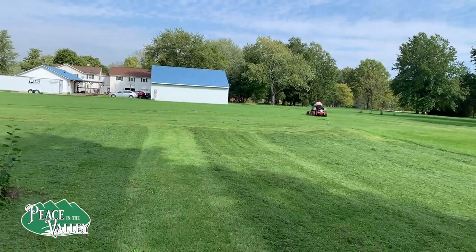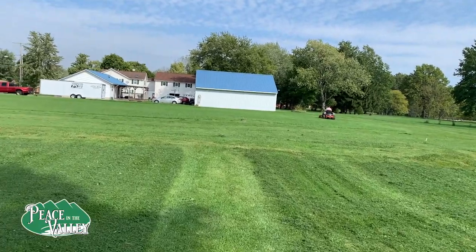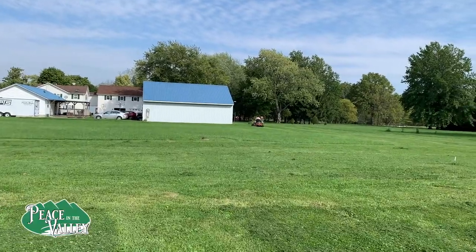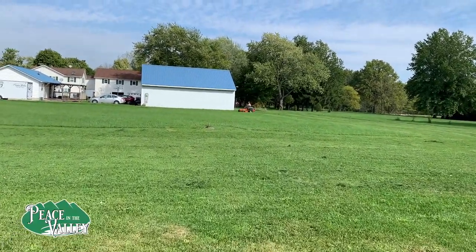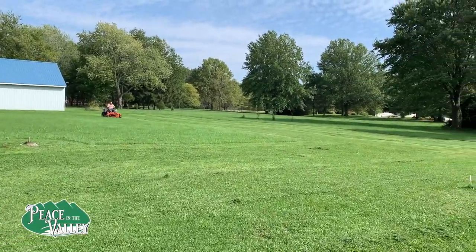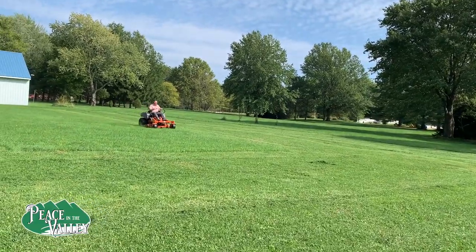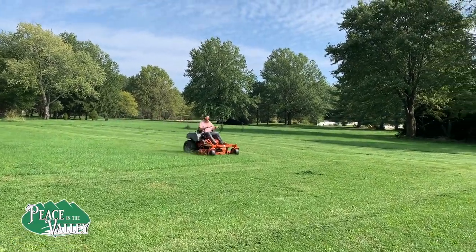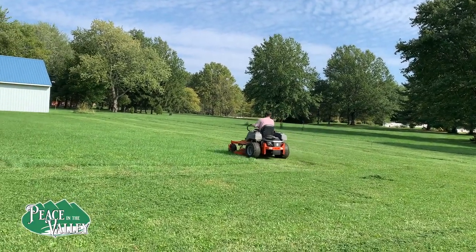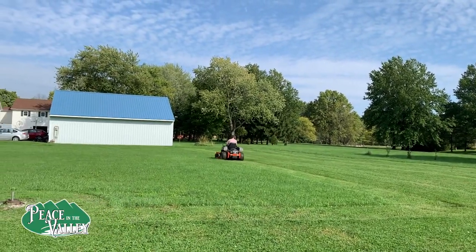Keep in mind that if you are changing the battery on your mower, whether it is a zero turn or a standard rider, check out and make sure that your terminals are on the correct side. That your red is the same as your previous battery. When I went to Napa, they sold both. You can get the red on the left or on the right. So make sure that you be careful before you come home with the battery. Otherwise, you've got a 50% chance that you're going to be going back to the store.